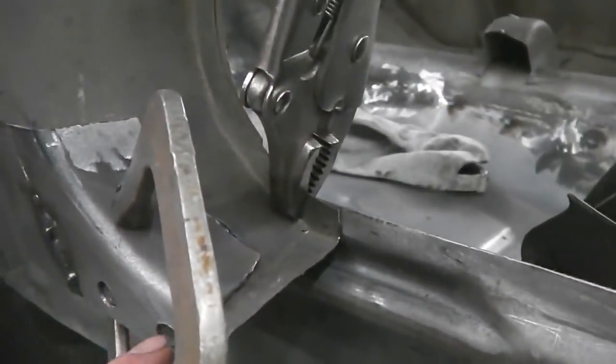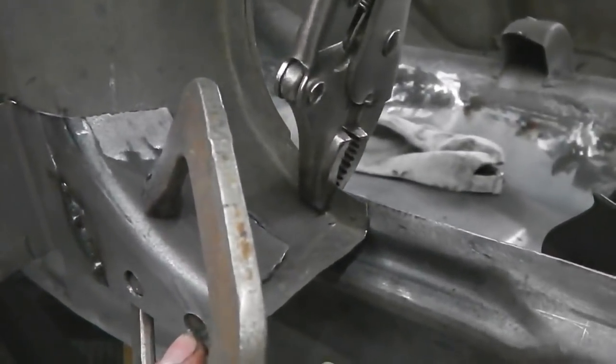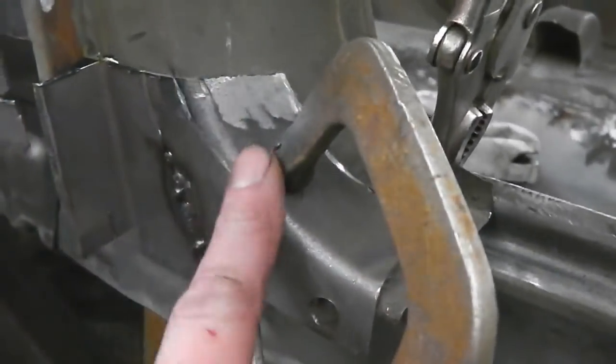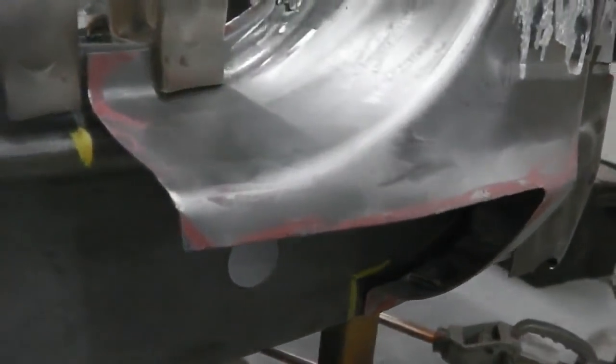So we want to replicate that idea, so we just put a lip in it, underneath the metal, and spot weld the lip in, and then we've got something then, should be good. So I think we've got away with that. We just need to trim the bottom of this, follows roughly the depth of that one, because that overlaps the sill.